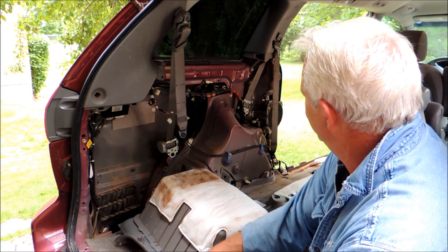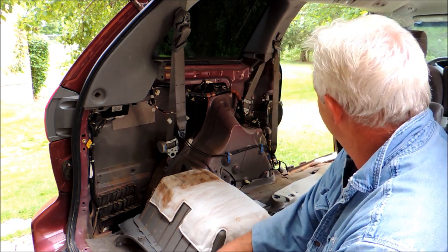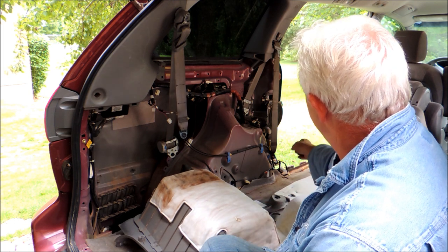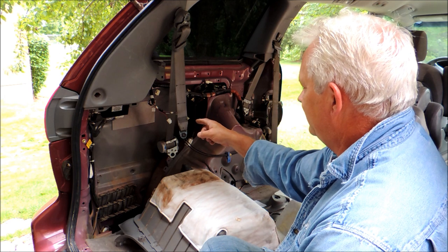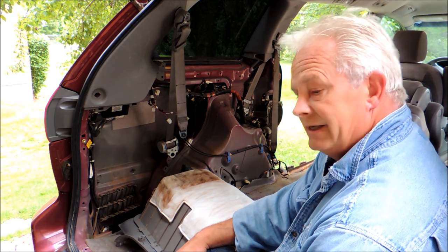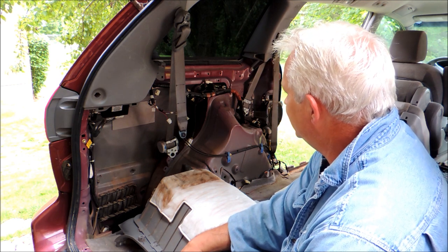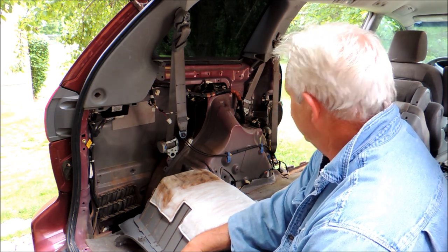Anyway, that's how you get off the rear panel. Make sure to find the clips if you break any and put them back. Make sure to connect everything. As far as the steps go, just a quick recap: the front step plate/trim plate to remove, the interior light, the seat belt anchor, the knob, the rear seat belt anchor, the light, the rear trim panel and its three child seat anchors — that was it. As far as tools go: half-inch drive 14mm socket, small flat blade screwdriver, trim tool if you want, and a 10mm socket and ratchet to remove the back. Very few tools required.